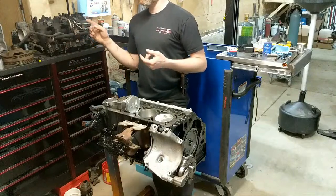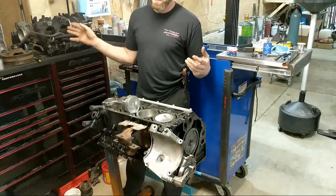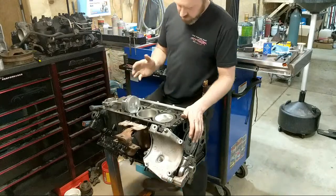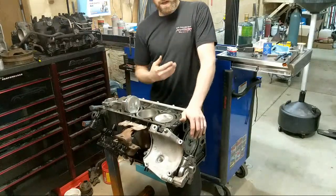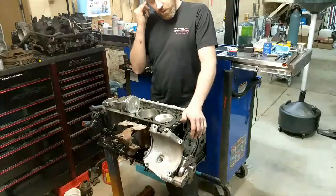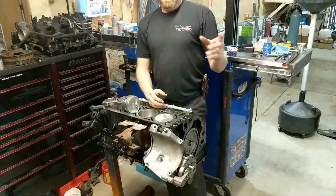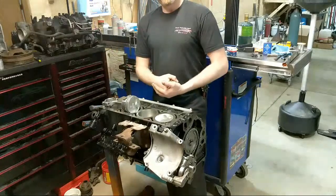The 706s - if they have a battery emblem on the head, that's a head prone to failure. This one does have that issue. I'm going to use the battery heads in case I need to sell somebody a set of heads - I'll give them the 862s. I can always find another set later. I'm concentrated on low speed airflow with this engine. I want the stroke because it's going to help draw that air in longer, and I think that camshaft is going to give me a very good advantage for getting that low speed airflow picked up and rammed in there at the last second before that valve closes.